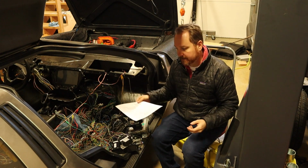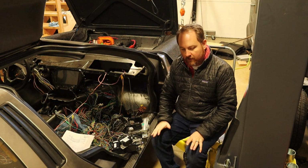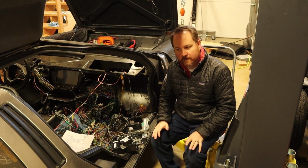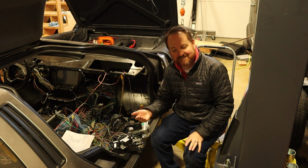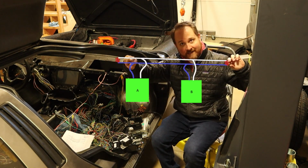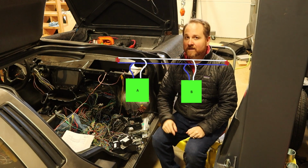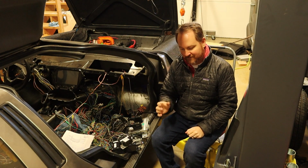And why is that? It's probably helpful to know how a CAN bus is supposed to work and also how a CAN bus works in practice for this. So in principle, it's a line with 2 resistors on the end, but in practice, that is not how it's actually hooked up, I've found.